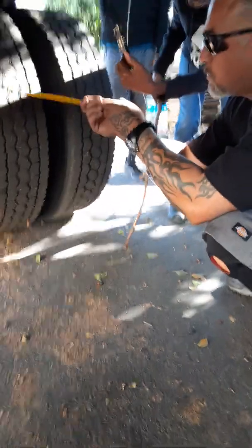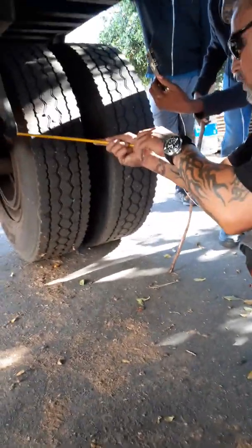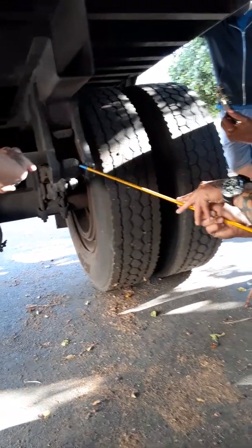My U-bolts, bolted tight, no cracks and not missing. My suspension does not have shock absorbers or airbags, but I do have an adjustable torque arm. The torque arm should not be cracked, no illegal welds, bolted tight, the bushings are not torn or missing.